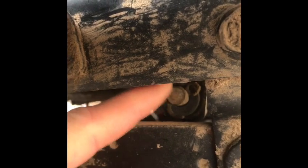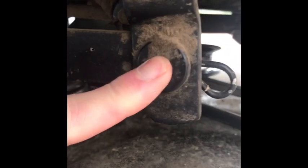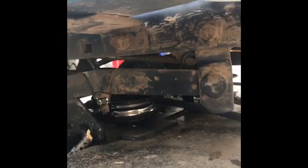There's a little clutch lever pin right here that we got to pop off next, and then there are suspension arms on each side that have cotter pins down here as well — two on each side. I'm pretty sure it's pretty simple after that, so just do both sides and then see where we're at.